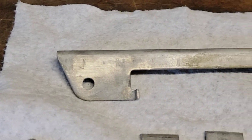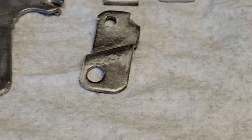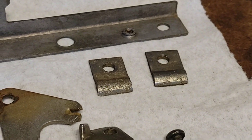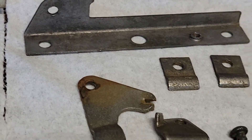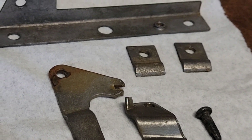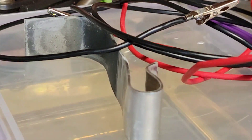Going back to these, they came out very nicely. Once again, this can be polished, but I am not actually going to be polishing these. These just came out really nice. And here is unplated. These are flash rusting, so I will need to put them back in my vinegar bath to get that flash rust off and kind of scrub it a little bit. Let me get those cleaned off and ready to drop in, and I will be back in a minute with my full setup. Here is the electrolyte solution for the tin zinc plates that I have right there.